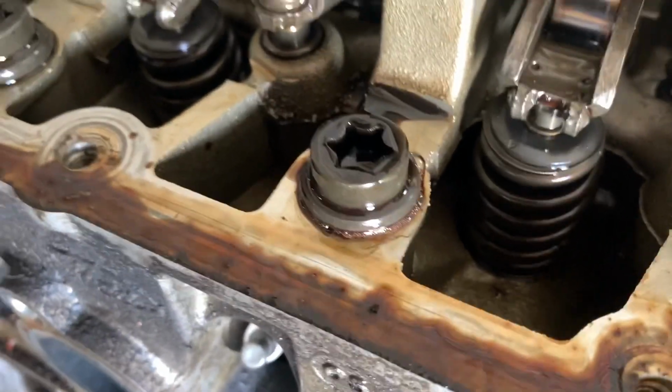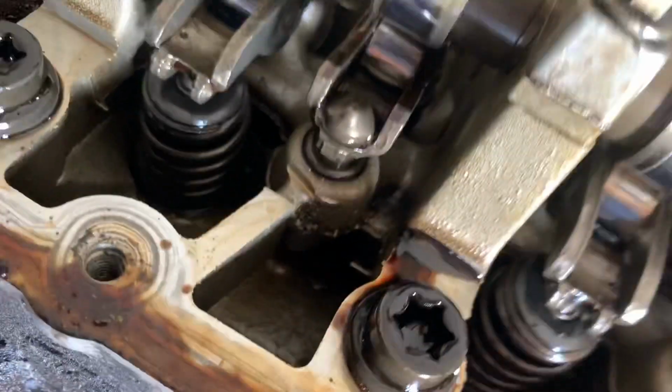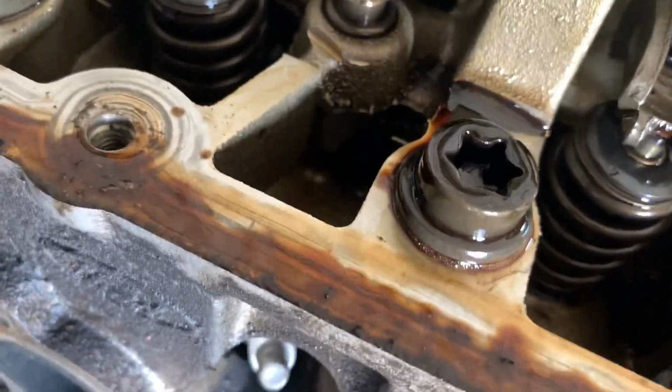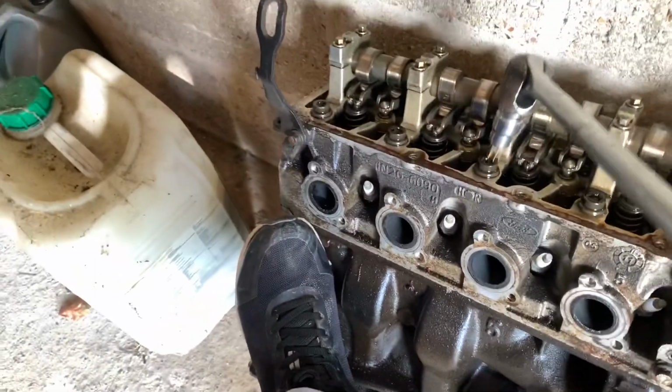Crack off some of these head bolts. They bubble, and you'll hear sometimes pressure releasing from the old assembly lube that's in these from the factory, which is incredible. They literally crack and they make almost like a hissing sound. Yeah, it's pretty. But yeah, the breaker bar does remove it, by the way.